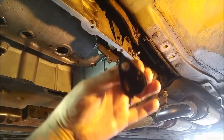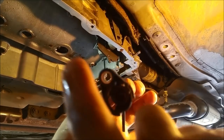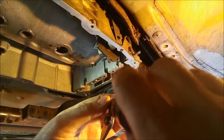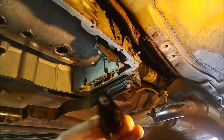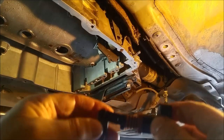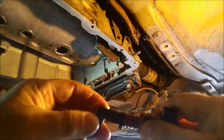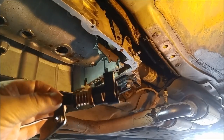Another thing to look out for — you can see how that bracket is sitting straight down, but the bolt hole is actually at about 11 o'clock. So you just manoeuvre that little rubber around so it just sits aligned. If it's pulling one way or the other, these rubbers won't last as long — they will tear a lot quicker. So try and align that as best as you can. It's a little bit fiddly to push it into that little hole. Also don't forget to put the spring in before you push the pin right through.